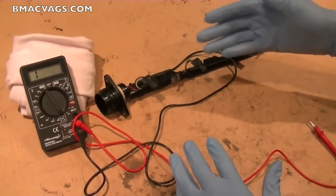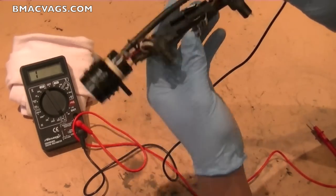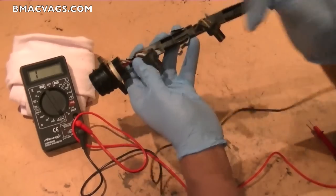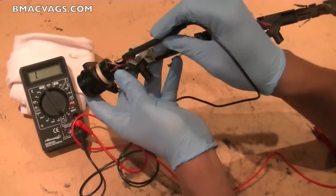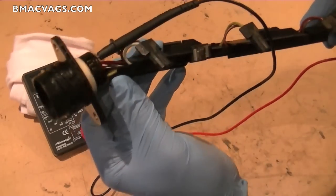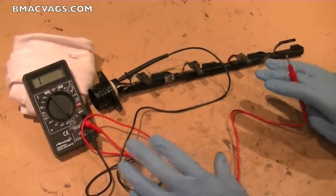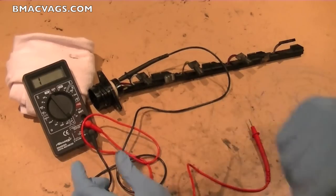You do the same with the red wire and each individual wire to check they're all okay. I've actually done this already so I won't go through every one, but I'll show you one anyway. Use your earth probe — it's probably a bit oily but probe it. I'm currently probing the red one. We can check the continuity here and we've got continuity, which eliminates that as a problem. So now on to checking resistance.